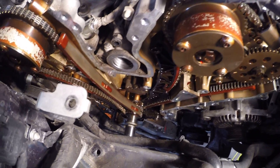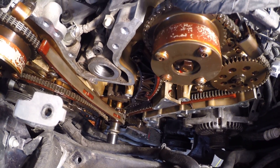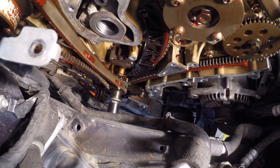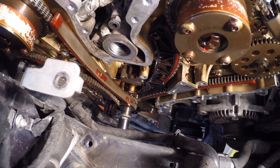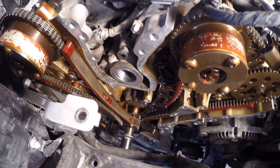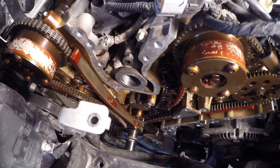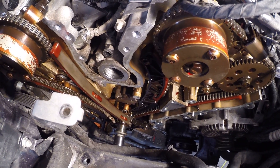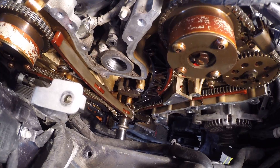There it goes back out — that shouldn't happen. And that's why this thing is rattling, because when you first start the engine up and there's no oil pressure behind that piston, the chain is just flopping around causing noise. Mid-2000s 3.3 liter Hyundai V6 with timing chain noise issue — that is the problem.